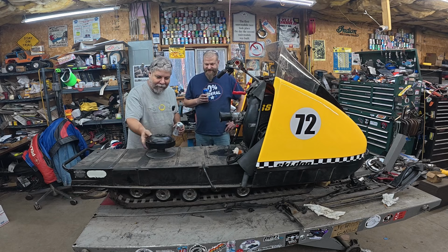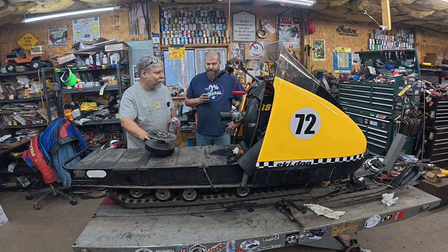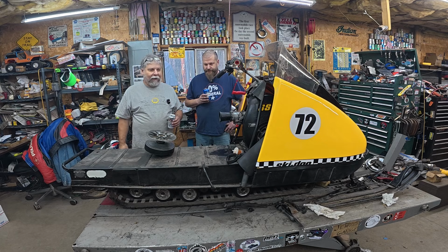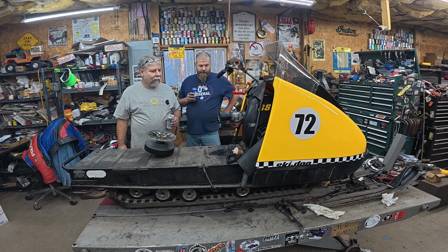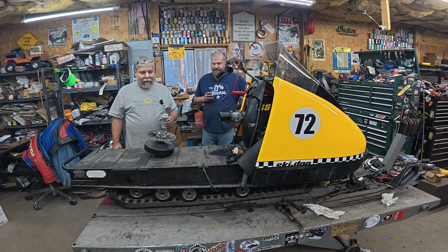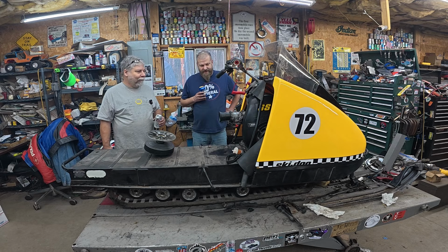That's not a retaining bolt. No. So these Skidoo clutches, they just kind of screw on. They should tighten up when the belt's on. Yep. But there's no belt on this one, and it was supposedly a rebuilt engine, so probably never got locked down good. Huh, crazy. I didn't know that about Skidoos. Easy to pull off the clutch now though. Well, yeah, now we're all set for whatever clutch you're going to put on it.